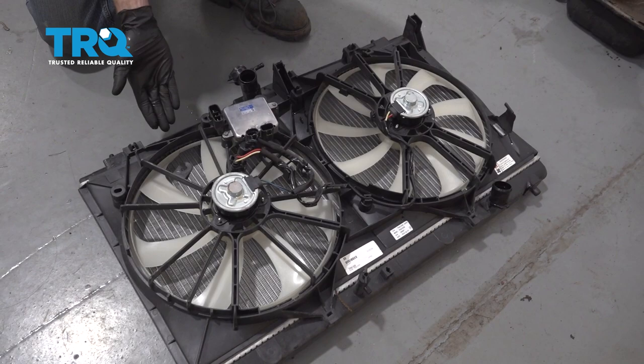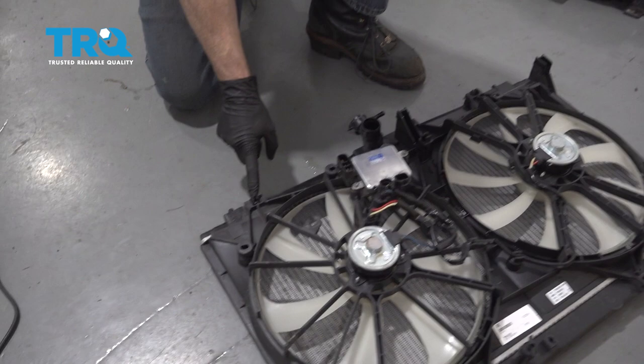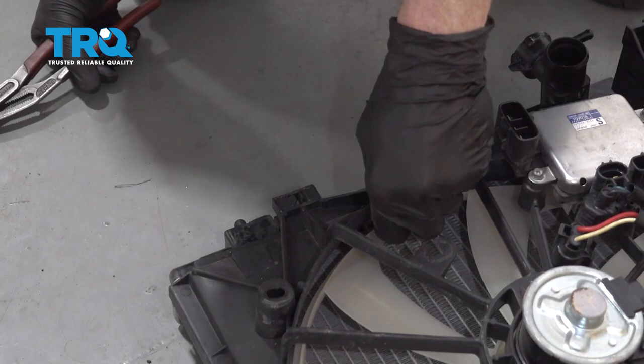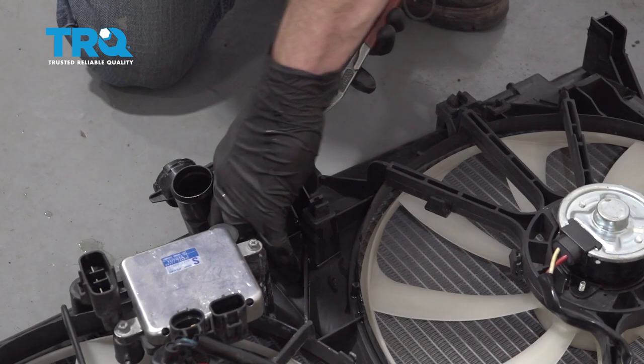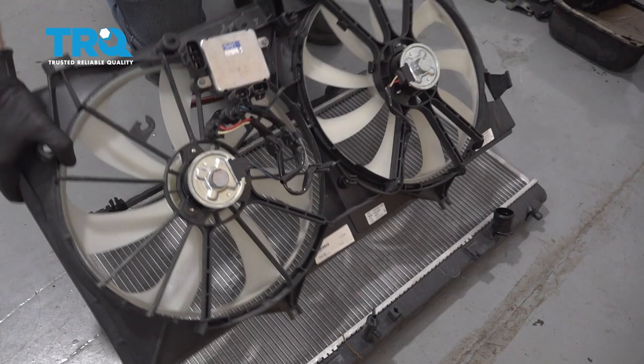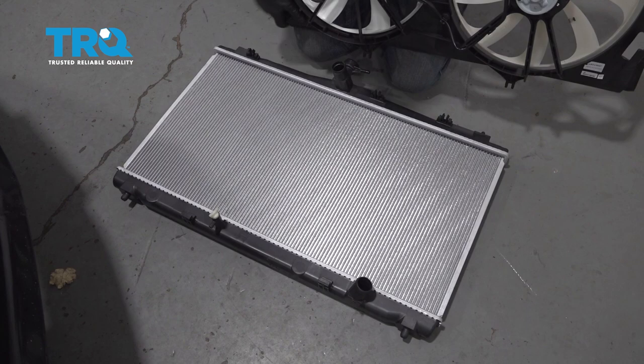Now at this point I can wiggle this around. You want to make sure it is completely separated from the AC condenser, which is located right in front. Let's go ahead and carefully start lifting this entire unit straight up and remove it from the vehicle. With this out of the vehicle, we can continue on removing the fan from the radiator. Up along the top of the radiator you're going to find some little clips — squeeze in on the tabs and you should be able to lift this up and remove it. Go ahead and do the center one and then move along to the far end. Once that's off, go ahead and roll it just like this and remove it from the radiator.